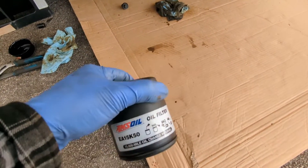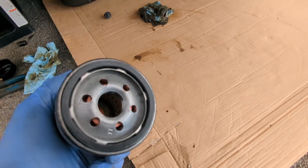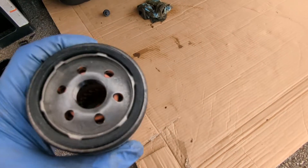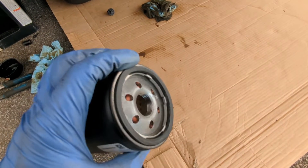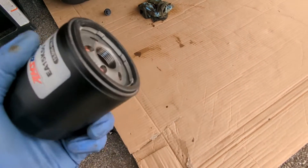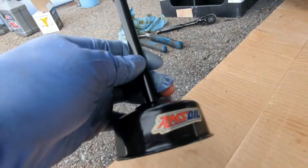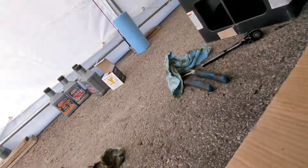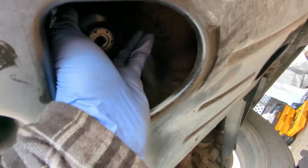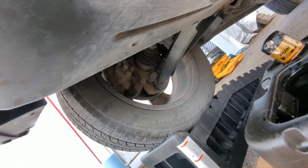This is the new filter. I'll always put a little bit of oil in here just to get everything to start absorbing so that it doesn't do it once you start the car. There's already oil in the filter, and I'll put a little bit of oil just to lubricate the seal here, so when you put it on it goes on a little bit easier and you get a nice snug fit. Another thing I want to show you guys — Amsoil has these cool little filter ratchets that basically fit over the filter. So when you have these tight spaces to get into, you just put this ratchet on with an extension on your ratchet, and it's easy on, easy off.